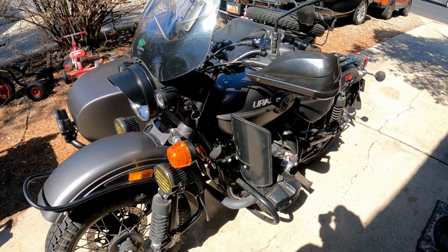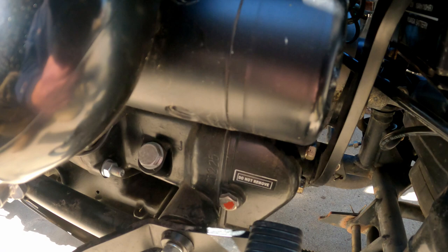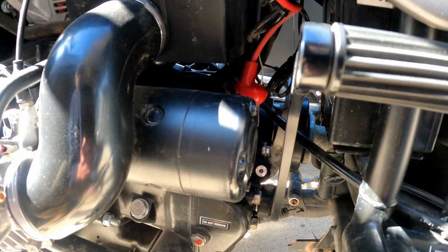I really like the bike. I haven't had any problems with it. I have almost 9,000 miles on it. The only real issue I'd point out for other owners is that one time while I was going down to San Diego, this little bolt right here came loose and I lost my clutch. So I put some Loctite on it, screwed it back in, and I've never had any problems since.